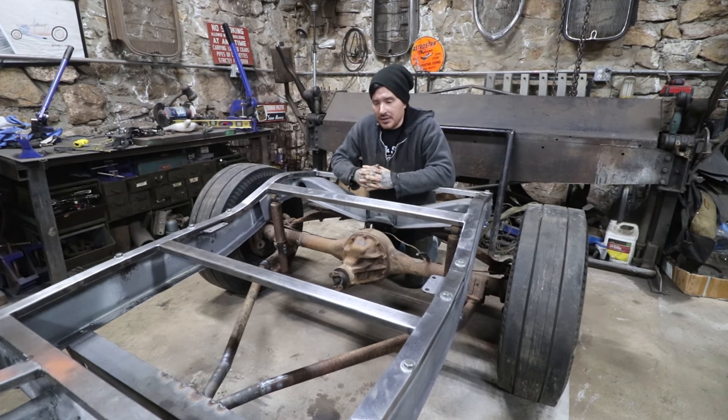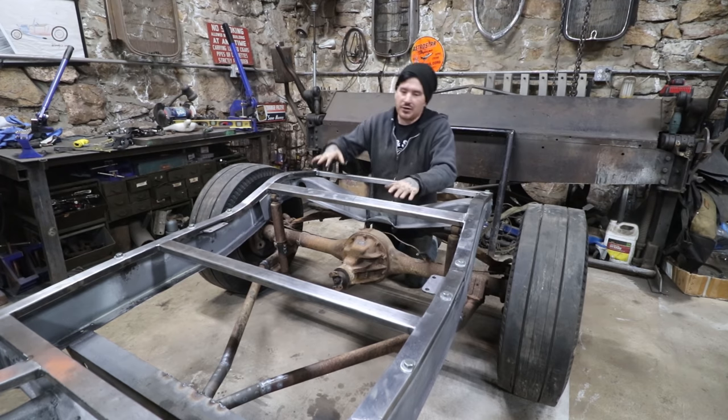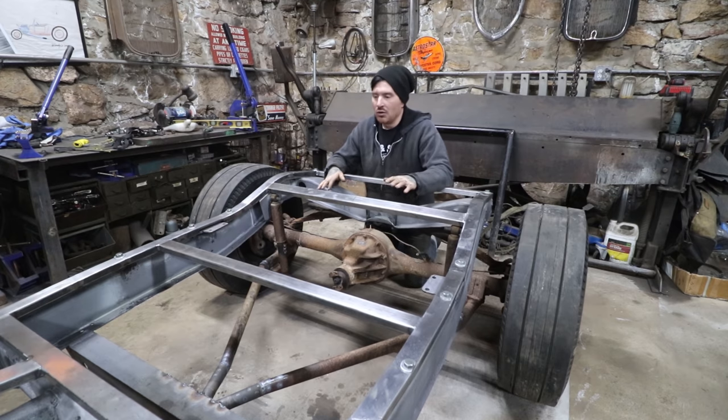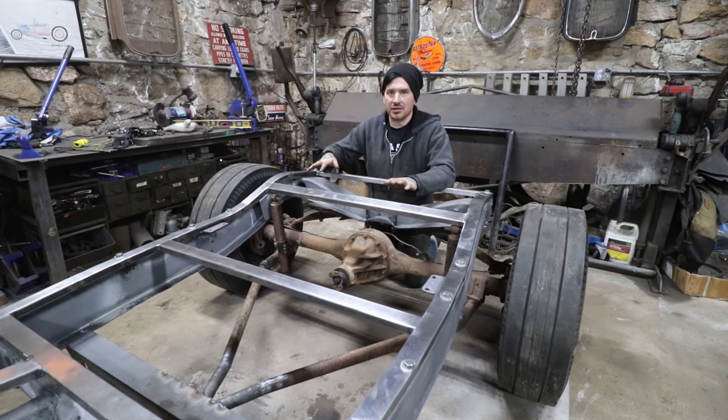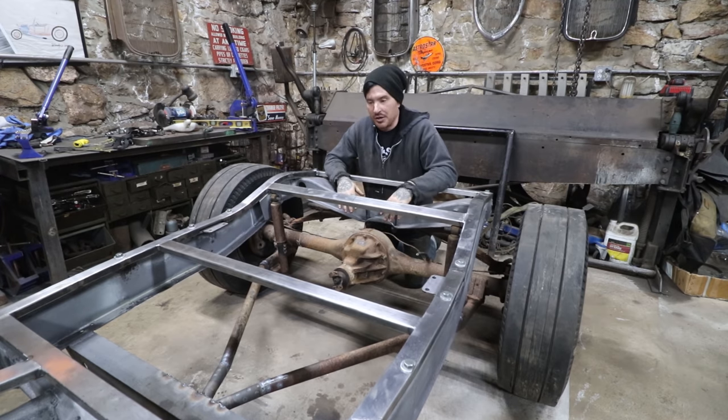So again, to reiterate why we were doing this, the way they had the suspension fixed in the front, it was essentially making the rear radius rods like sway bars, and when the suspension really went up on one wheel or you hit a hard bump, it was basically fixed front and rear, and it was just twisting instead of actually moving when it was going up and down.